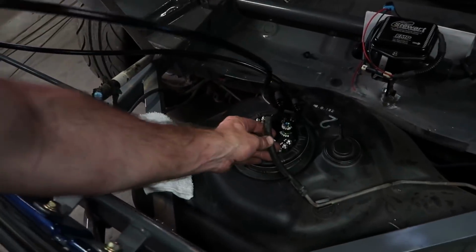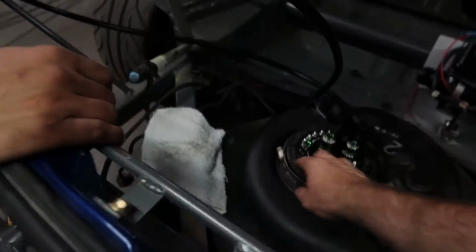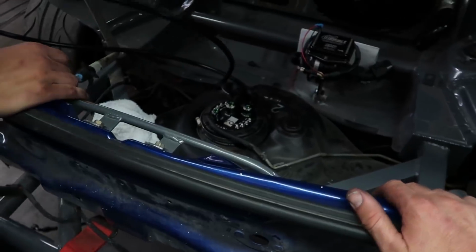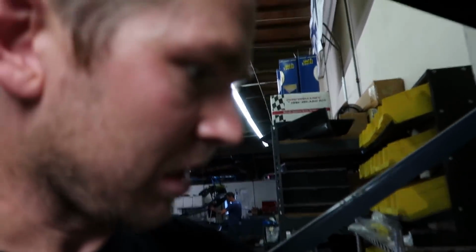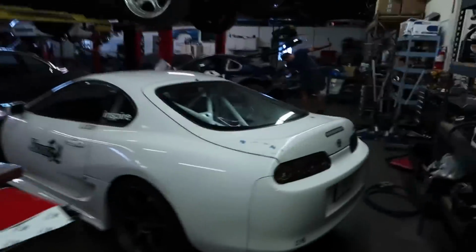First, we're going to get some Gates submersible E85 soft line, because if I didn't do that and it's venting, it'll eat itself alive, and over time I'd probably ruin those pumps. Maybe one little practice season with the car, you'll probably go ahead and ruin it. So we need some of this guy here. This is 5/16, I think. That is the right size. Let's go over there and check, otherwise we have to do one size smaller. Either way, okay, let's head back over there.